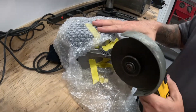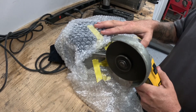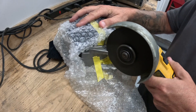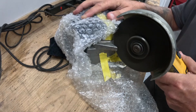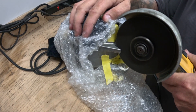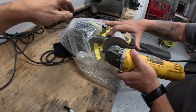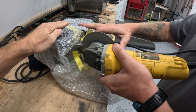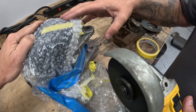We have the alternator on the bench and while we're making this cut, you definitely want to cover this as much as you can — cover all of the holes on the alternator casing. You don't want any of these metal shavings flying into the casing because it could damage it, and then you'd have to take this thing right back off and do this all over again. We put three vertical lines and made a little cut first using the concept that you can always remove but you can't add back. So there's a little bit of trial and error. Ultimately at the end of the video I'll show you some reference marks of exactly where we made the cuts, so maybe you won't have to do as much trial and error.